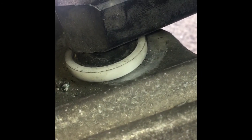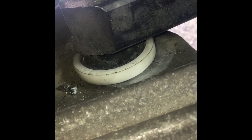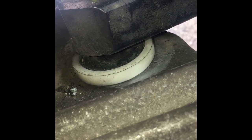So with just that little bit, it provides enough lubrication, but it doesn't squirt out everywhere. If I did double that amount, you would see grease around the perimeter of this pad, and then it just gets messy from there. So just a little bit, create some lubricity, create some of that microplating, and it stays pretty clean.